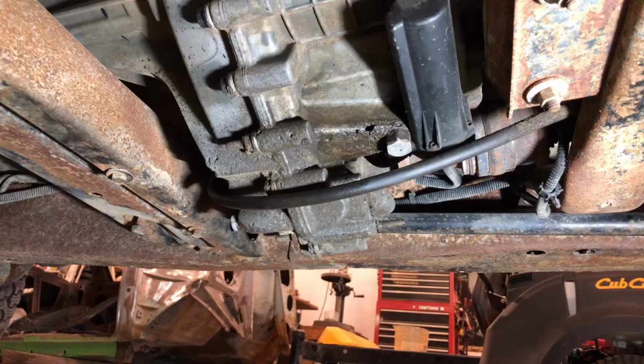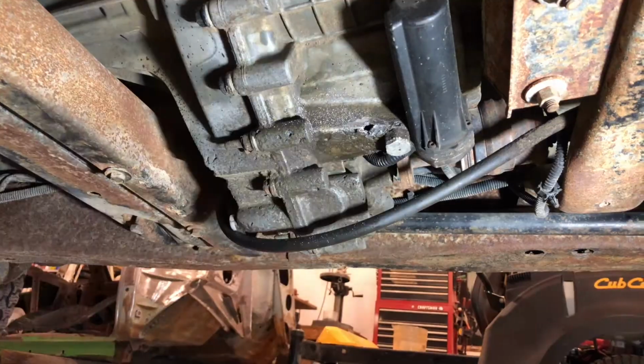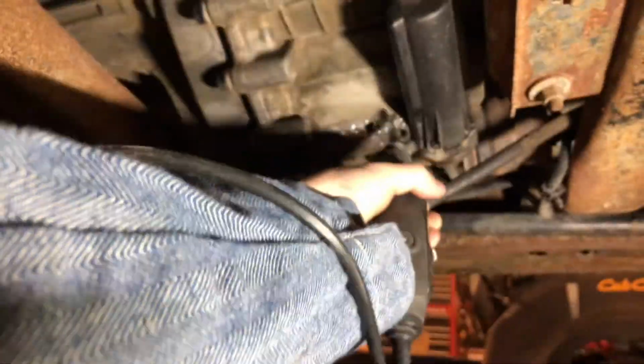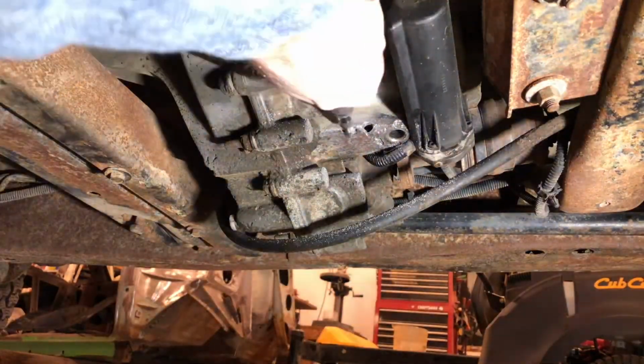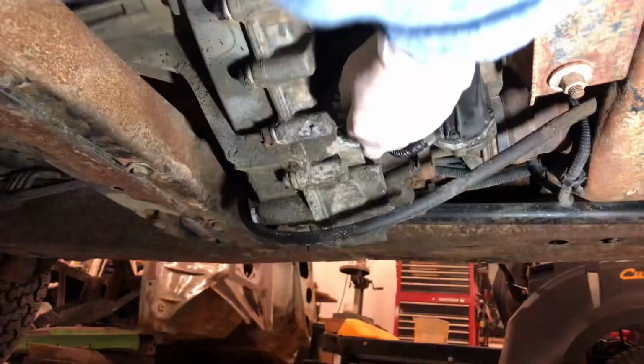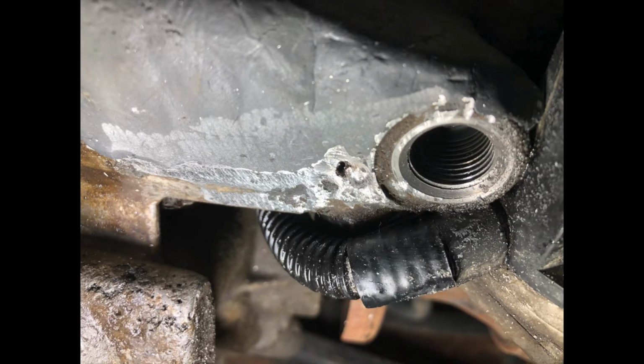Another little bit of B-roll that I filmed, I'll run that here. That was when I fixed the hole in the transfer case, and it was a whole thing. I ground it down, I patched it with some of that two-part epoxy stuff that you knead together and stick on there like Play-Doh. Started filling it up, and it was pouring back out again because I missed one little hole next to the big hole. So I drained it again, repatched it, then filled it, then it was good.